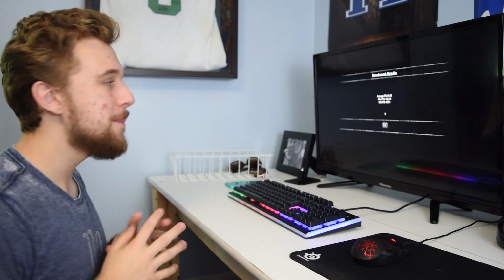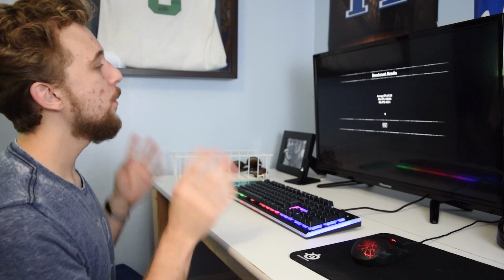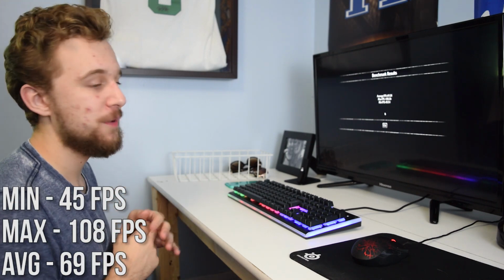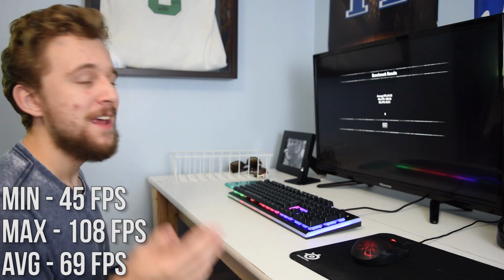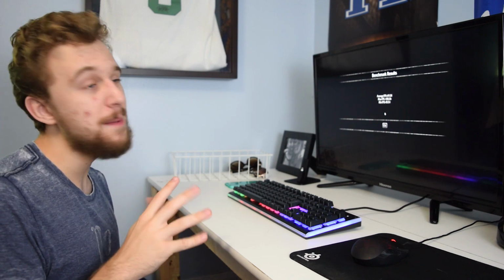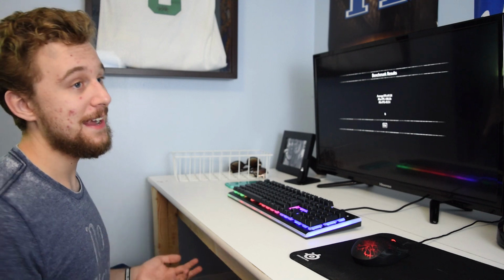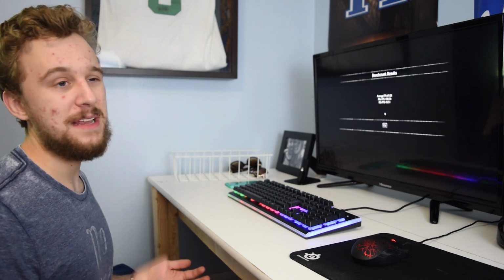Alright guys, so now that the benchmark's done, you can see the results here. I'll show them on the screen because you probably can't see it. But we have an average FPS of 69, a maximum of 108, and a minimum of 45. Now those frame rates are very reasonable for this title, but the one thing I hope to achieve is to get that minimum FPS a little bit higher, maybe into the mid-50s, maybe even the 60s with this overclock. Now this overclock will most likely not get the minimums up to the 60s without adding voltage, but that may be for a later video.